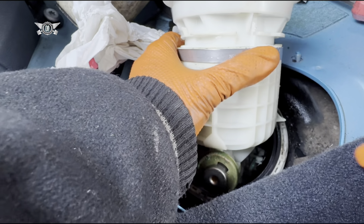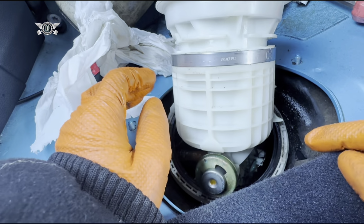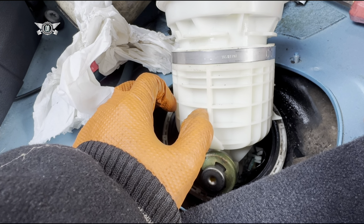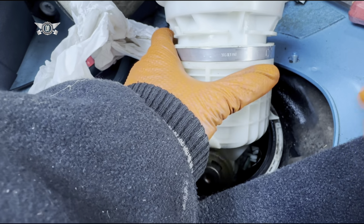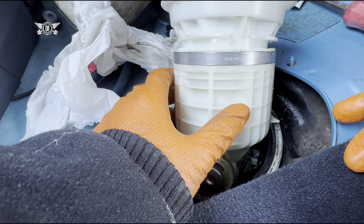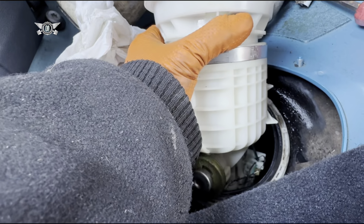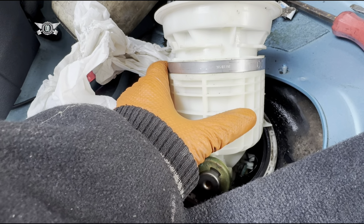You may find that inside of there, those little cables there is a fuel gauge on this side as well, and these wires here, you may actually find that they are all broken into pieces. So technically, if you find that, it would probably be a good idea to actually replace this whole unit. Just like I replaced my fuel pump the other day, which had all those little wires broken. So it could be an idea. Right, so I'm gonna have a fight with this for a little while and try to get it off.